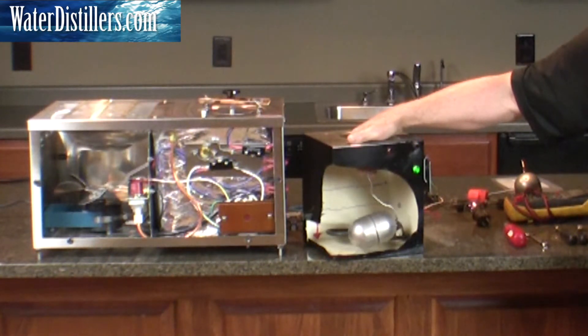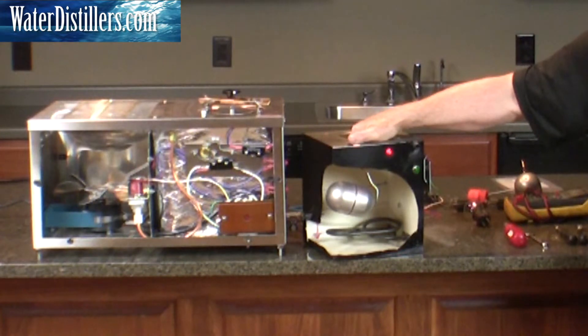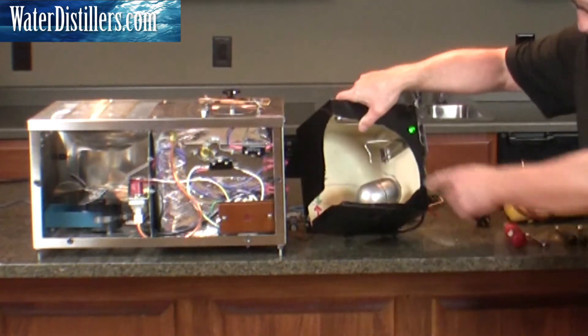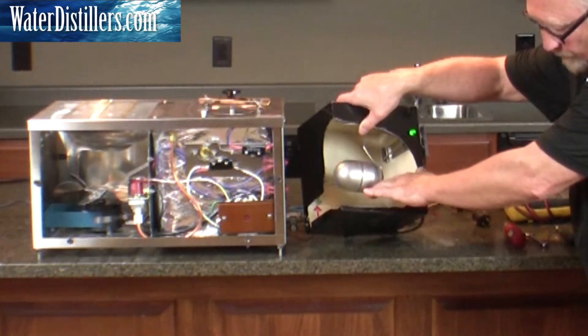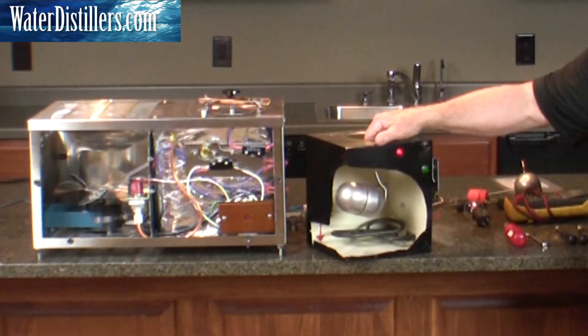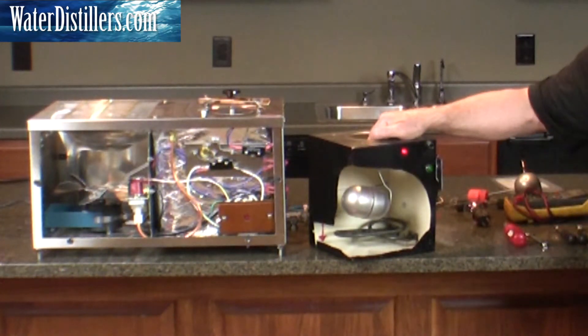The water's going to try and fill all the time until it gets up to the point where it turns the heating element on, and when it gets up high enough it'll shut off. At the top level, notice there's a kink in this arm of the float. As that goes up toward the top of the boiling chamber and the water shuts off, you should have about a finger's width between the top of that arm and the inside top of the boiling chamber. That's about the right setting for it.